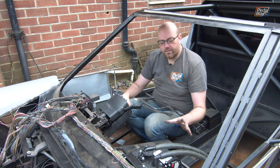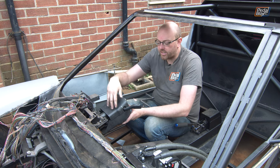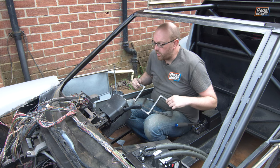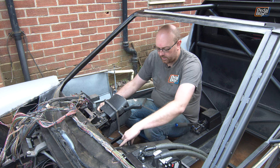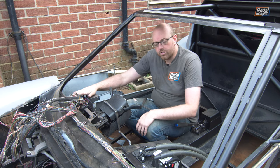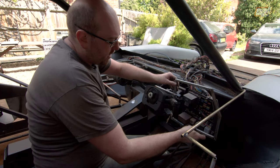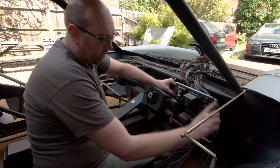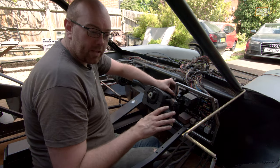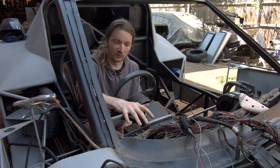With the passenger side of the dash's front edge defined, we can work on the driver's side. We're going to work pretty much to the same limits as what was built onto the TT and A3 around the steering column — there's a dip in the shroud and that's where we're building the framework. We've already built part of the framework which drops in over the top, still leaving enough room for the column to go up and down and forwards and backwards towards the driver. It runs across toward the fuse box, with a nice big opening on that side — that's what this frame is for — so you can access the fuses and relays. Once this is welded up we should be pretty close to having the entire lower framework of the dashboard completed.